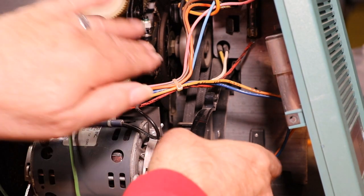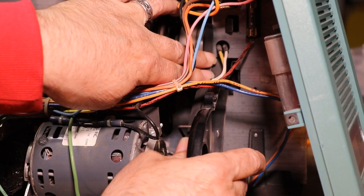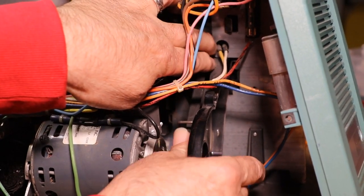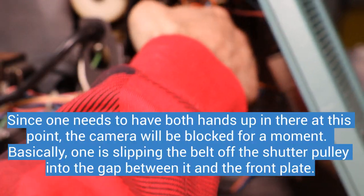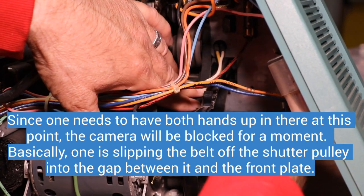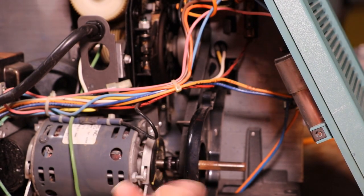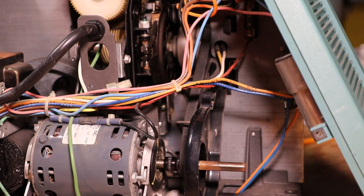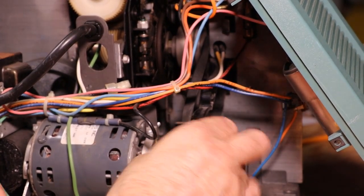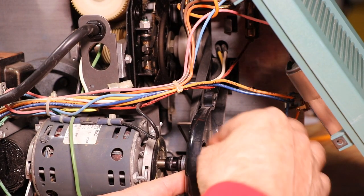I'm reaching up on top and I'm turning this and slipping it at the same time, trying not to break a wire. Sometimes I'll just take this little back side of the fan housing off. There it goes — it just slipped off the top. Even when you get it that far it can still fight you. What you can actually do is pull it off and around the end of the motor shaft and then you have a lot more give — it'll stretch that far, won't hurt it.